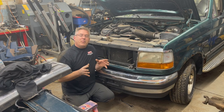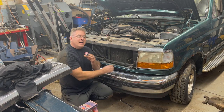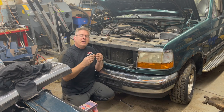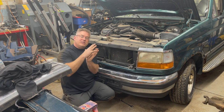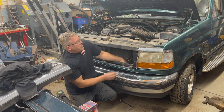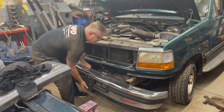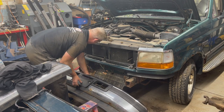It's a dirty job but I've got three of the four bolts taken off. One of them on the driver's side is just holding the bumper in place so it doesn't fall off. On the passenger side I did have one bolt that kind of stripped or spun. What you need to do then is tilt the bumper on an angle to pinch that bolt into place, and then you'd be able to back that nut off. So we'll take off this last nut and we should be able to just pull the bumper right off and set her down.